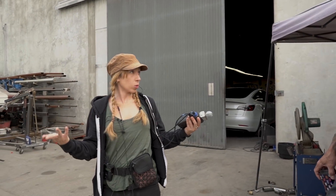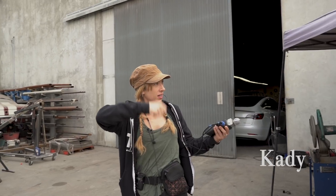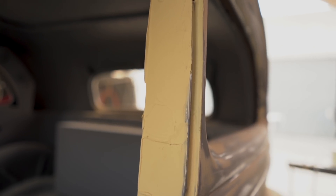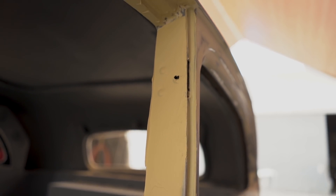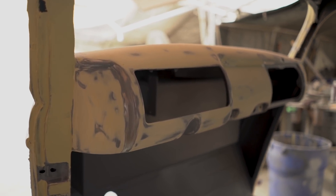Just the simplicity of the term metalwork — you're going to use that zappy thing to pull it back and then the hammering? We use a torch and do little dime-size spots, heat it up, then hammer and dolly, cool it, and it just tightens the metal up. Then we'll probably put some ribs underneath it to hold it in place so that later when it's sitting in the sun, it's not just a shell.